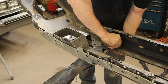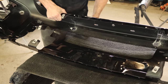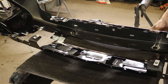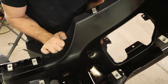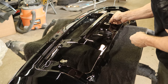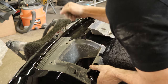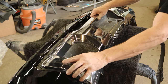Our new valance comes with new J-nuts, but we still need all the bolts, so we're going to use our multi-purpose trim clip pliers to hold the J-nuts and unbolt them. Don't try using your fingers — it doesn't go well. Now we can pop out the little bezels for our parking sensors and snap them into our new bumper. These outer ones don't give that same reassuring click the inner ones do to let you know they're installed, but they're in there. Put all our J-nuts on, snap our tow hook bezels in, our license plate cover bezel filler — I don't know what they want to call that — and we'll put our skid plate on. High strength chrome-plated plastic, of course.